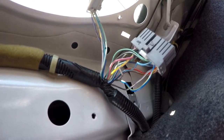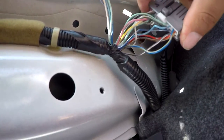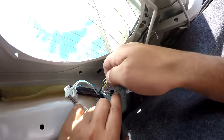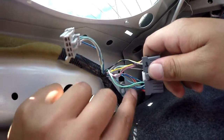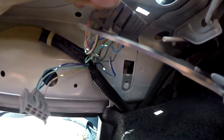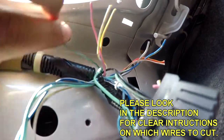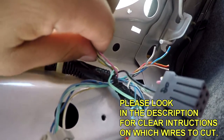There's a comparison of the old one and the new one — the new one is a Fusion 310 watt speaker. After you've got rid of the amplifier and the speakers, what you need to do is cut these wires. These wires go to the amplifier and what we're going to do is cut them and then reconnect them. The first wire you want to cut is the blue with yellow stripes, and remove the pink one. I'll leave a link in the description so you know exactly what wires to cut.